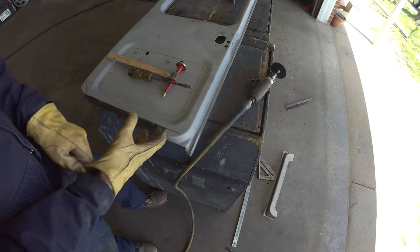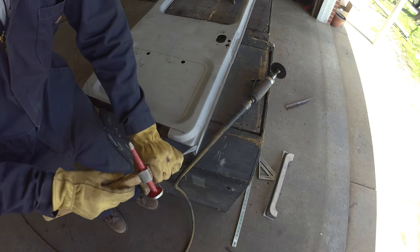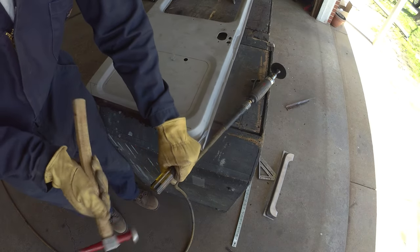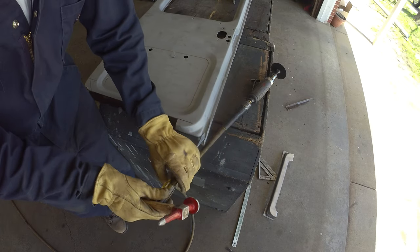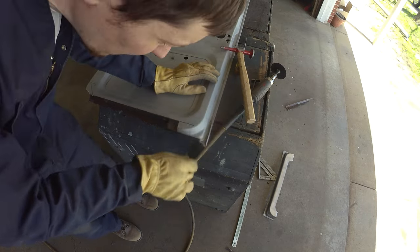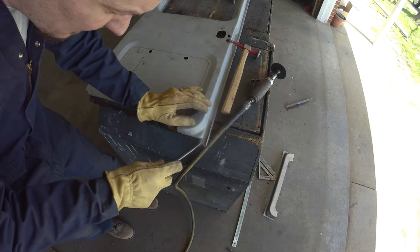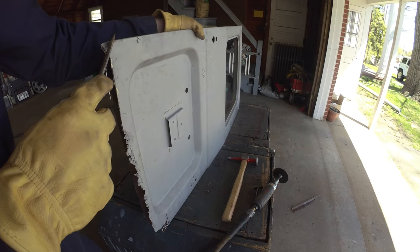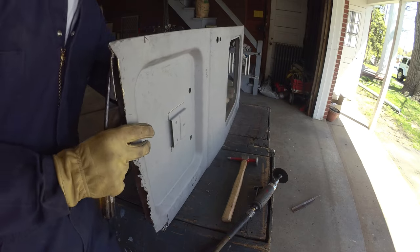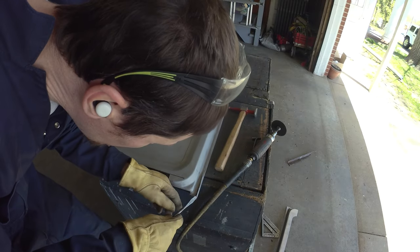So back over to this side, just to see what we need to nibble off this corner. Again, playing it conservative for a while. Kind of working this flange back where they pinched it. Metal-wise, we're not looking terrible there. At least let me get that cleaned out. And this bottom corner would need to get nibbled off, and if we just came straight across, we could fold over that bottom. So that's not too bad. This is all pretty decent metal on this corner, so theoretically, we could leave quite a bit of that, which would be kind of nice.